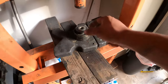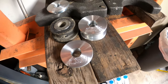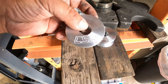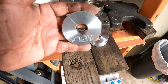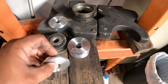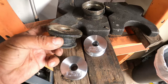Once the bushing is all removed, now we're going to swap them out for solid bushings from CSH. Here are the billet CSH solid bushings that are going to give us a really nice ride — well, it's the opposite of a nice ride — but they're really good for off-road use. This is going to be amazing: no body roll whatsoever in comparison to the rubber bushings we're going from.